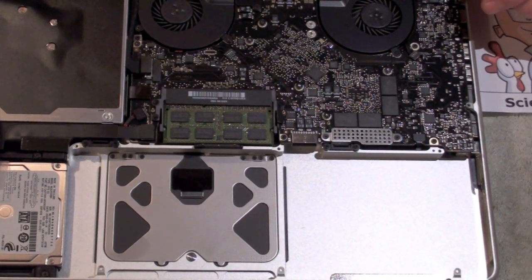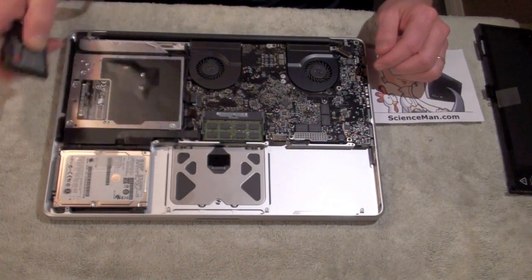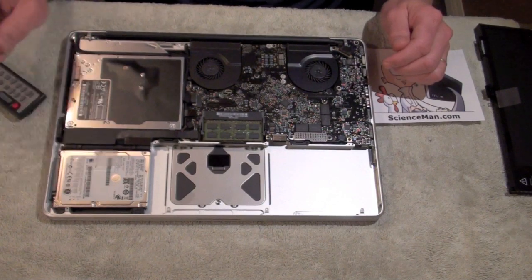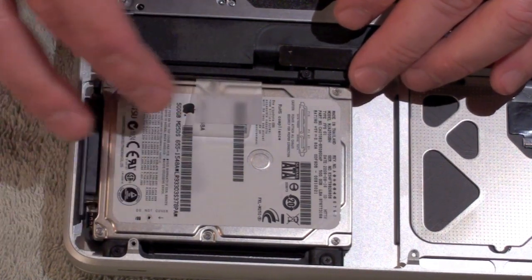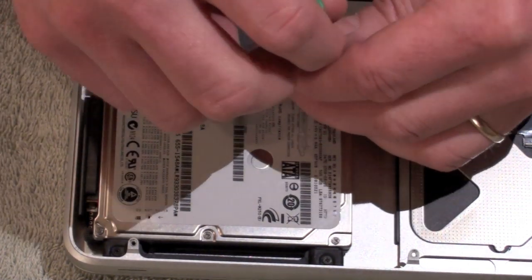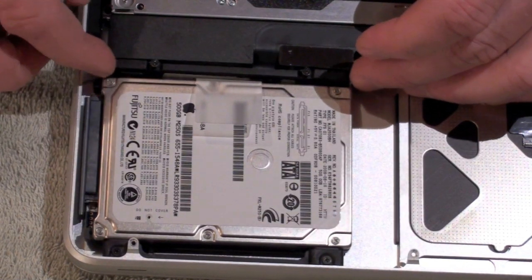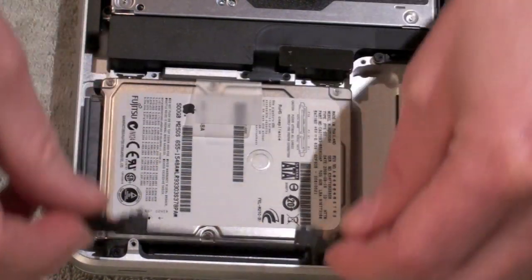Now we have free access to our hard drive. What we need to do is get the screws out to loosen that hard drive. For this next stage, we've zoomed in on the hard drive area and this removal is actually quite easy. There are two Phillips screws here and here that secure the hard drive. We just use our small number zero Phillips to loosen those two screws, and this bracket comes right out. You don't have to worry about those screws falling out — they're captured in there — so we can just set that aside.